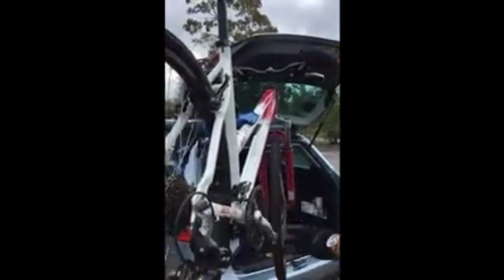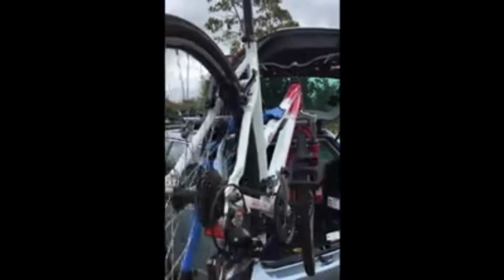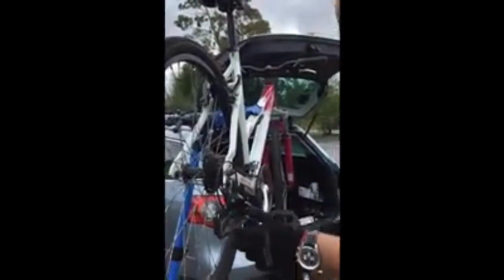We'll go the smallest at the back, which again is an extreme gear that you shouldn't really be using, but we're using it for the purpose of getting the chain to length. And you can see there, that derailleur has got hold of the chain. It's not hanging. If it was too long, it'd be hanging down. Of course, it isn't. It's up like that, so that's okay. So that's how you set your chain to length. That chain's now good to go.